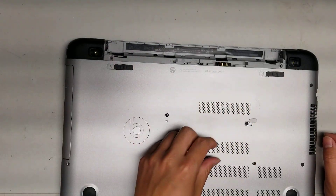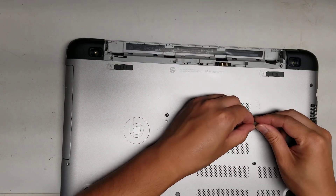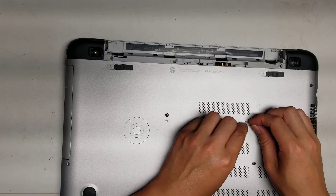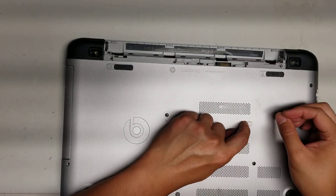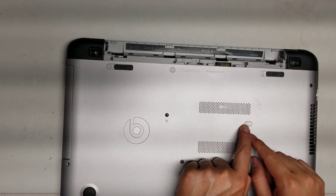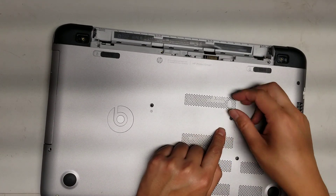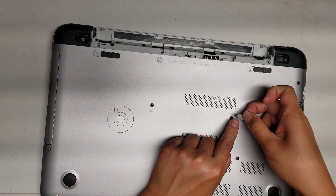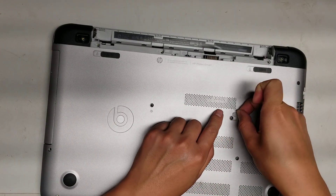You can see there's two screws under there. This plastic piece will be over this hole like this. Depending on how old or new the adhesive is, when you press on this where the screw is towards this side, it should lift this up and then you can pop it out, just like that. If you can't get it out like that, you can use a needle or a razor blade just to get between the two layers and then pry it out.